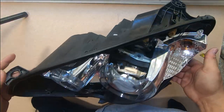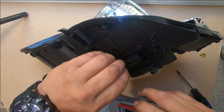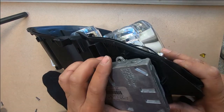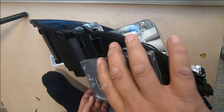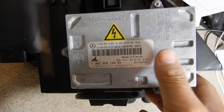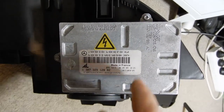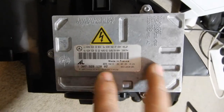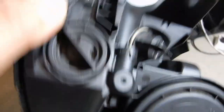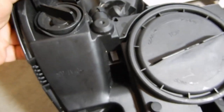The internals of your headlight are now completely swapped over. Plug in your ballast, pull the cable out a bit to give some slack, line it up and push it down. Make sure everything plugs in and everything lines up really well. Once aligned, put in your last three T20 Torx screws and that will be done. Make sure you pull out the old rubber grommets — there are two, one in the top corner — and move them over to your new case.